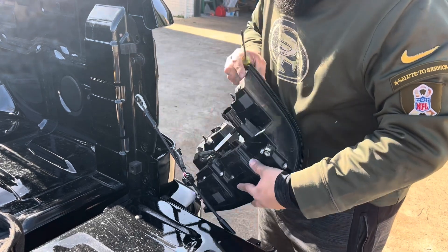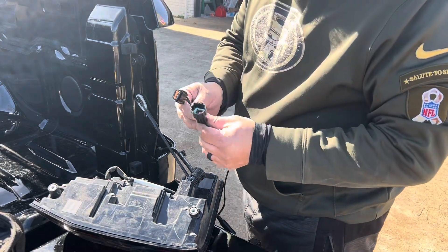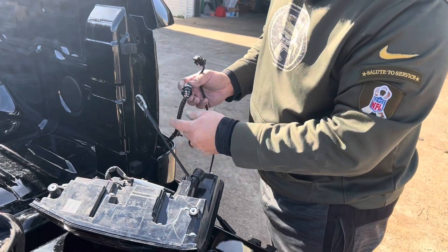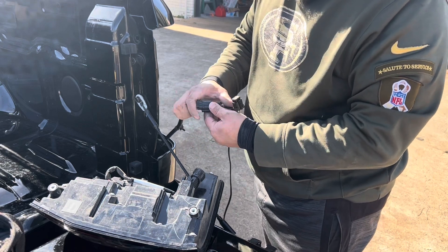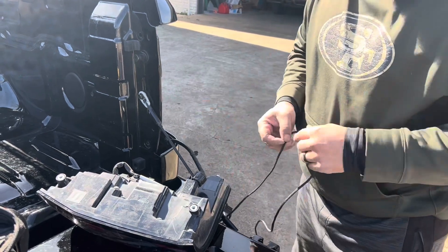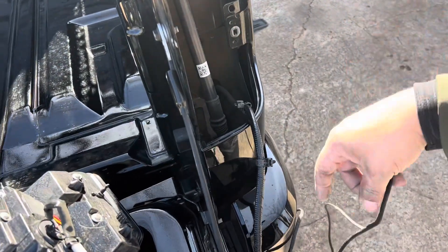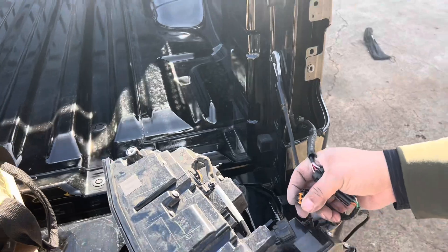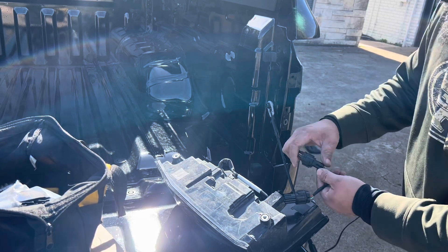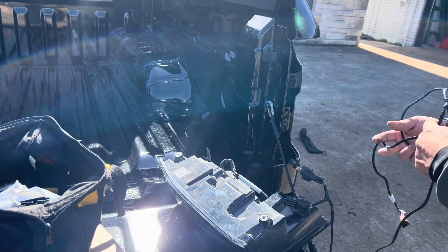Okay, so we've got the tail light off. This is the harness that plugs in here to get the power from the front. The main harness is going to plug here, and then this one goes to the tail light, which sends power. Once you put it through that hole, run the harness back to connect it at the other end. It's very plug and play with this harness — it's unfortunate we couldn't find one, since the dealer didn't want to sell just the harness alone and I couldn't find one on eBay that didn't require splicing.